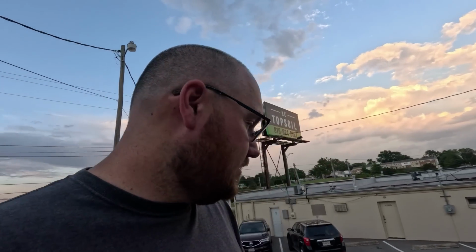So right now it looks like we're landing pretty good on top of the same RPM plot as last time. I'm putting a ginormous RPM output on my screen so I stop pussyfooting and not picking this thing up. Megan may have to bleep that out. Sorry, babe. I just need to get this thing to the RPM plot. I need to get it up to 7,200 RPM instead of 6,800. The boost is moving around a little bit on this pull. On the last pull, it was more stable. So let's just hope we're going the right direction. This will help quite a bit, hopefully.